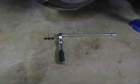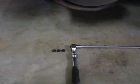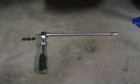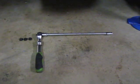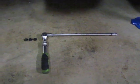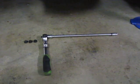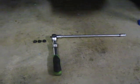Okay, I've taken those three 10 millimeter nuts off. This is the extension I used with my ratchet. It's right at 12 inches long, and it was perfect. Okay, so just to give you an idea of what size you'll need for that one that's way up the top. So let's go around, and I'm going to take the cover. I haven't taken the cover off yet. I want to let you guys watch me take the cover off.